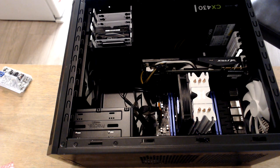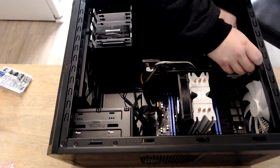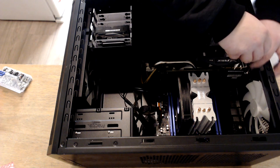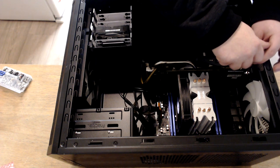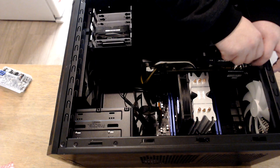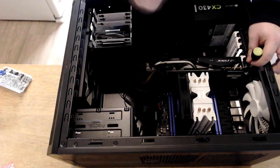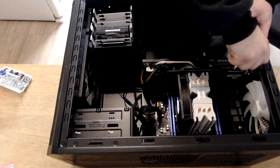We are going to be doing a little bit of an overclock on the GTX 970. I am going to do a slight overclock on the 2690. The core ratio is locked. It's not an unlocked processor. But what we can do is change the BCLK from 100 MHz to 105 MHz, which will give us a very, very slight overclock. But it's better than nothing.